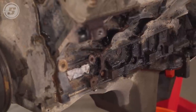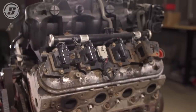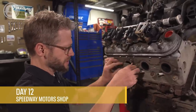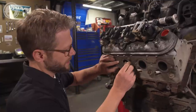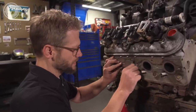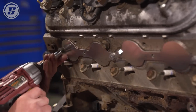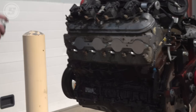Not some sort of failed science experiment. Not a ball of plastic and aluminum. We're going to wash this thing off quick before we start working on it. We're using this LS block-off kit that we sell, which is handy if you're going to store an engine, but it's also handy if you're going to wash it off. If it's going to sit for long, you want to make sure to spray some WD-40 into the exhaust ports and into the spark plug holes. Since this is only going to sit for five minutes until we rip it apart, we're not super worried about it here.